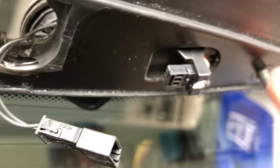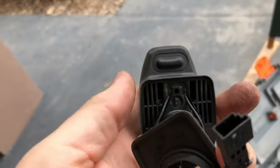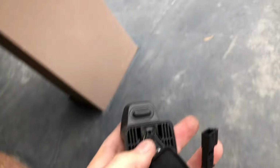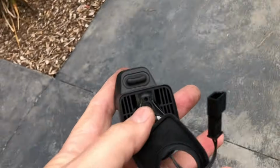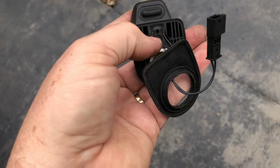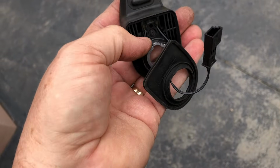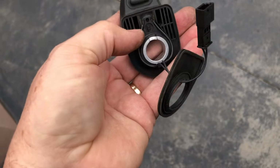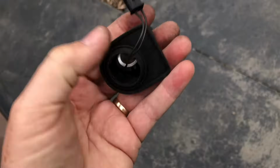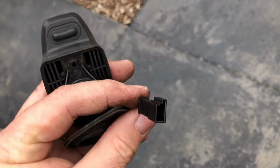But always plug and unplug a plug in order just to clean the contacts. We can get this guy out and have a good look. And if you have a look in here, you mount into the daylight, that is actually going up into a sealed section. There's a clear glue in there. So that's all sealed and totally waterproof, and the wires are all intact. There's no shorting, they're perfectly set apart. Everything's good through to the plug, so there's no issues here.